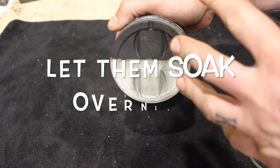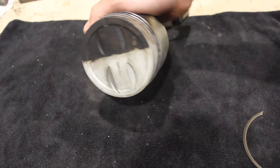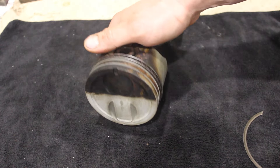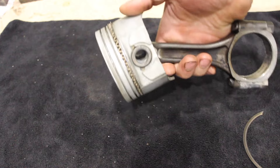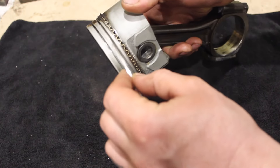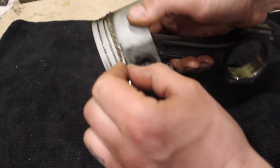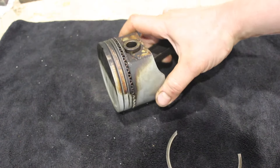I let it soak for a total of about nine hours. About four hours in I just rinsed off one side to get the majority of stuff off, then let it soak again — but I didn't do any scrubbing. This is what I'm talking about for how well this stuff works. The only thing I did was take a broken piston ring — the second ring — broken in half, and used that for cleaning out the ring lands. Works really well, and that's what you end up with.